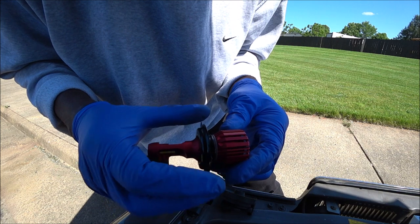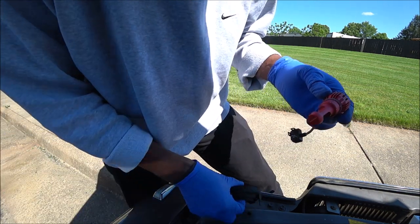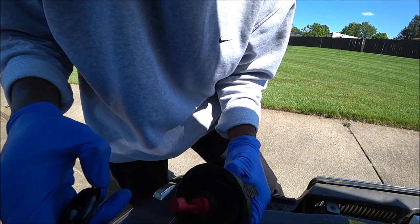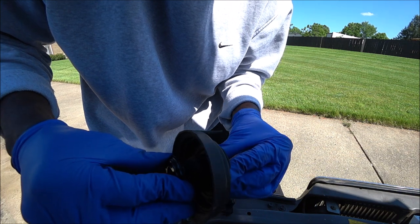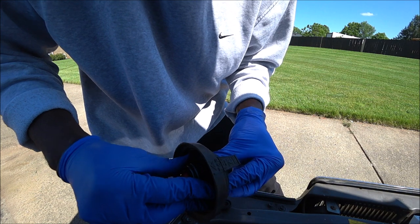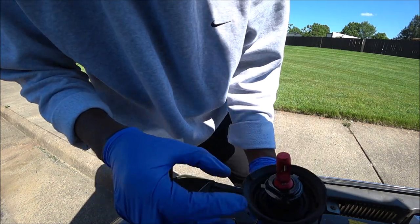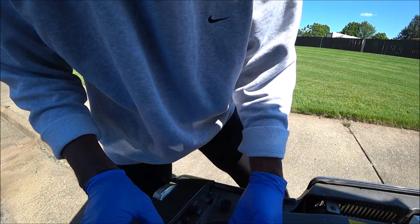So the first thing we're gonna do is remove this particular lineup section away from the bulb. Then we're gonna get our boot, stick the LED lamp in there and push it in all the way. Then you're gonna get this particular casing here and snug it down in there just like that while turning it clockwise. And push it down. And as you can see, once you push it down, you can adjust it just like that. The way that our construction is, the two bottom feet are the ones going in first. And that's how it will line up.